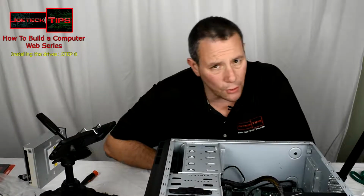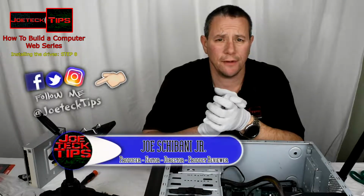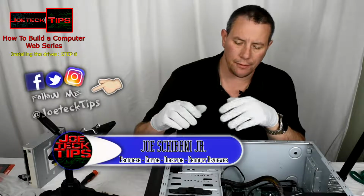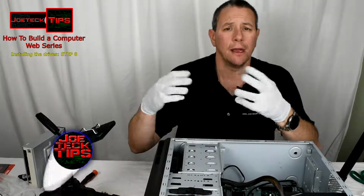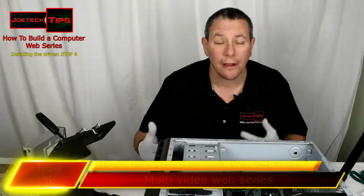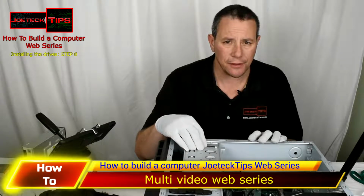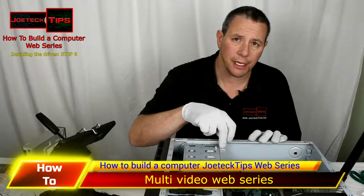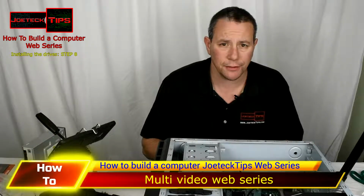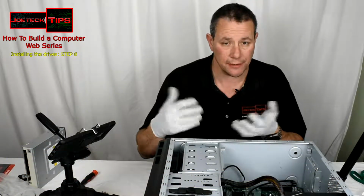Okay, now we're going to be installing the hardware, such as the SSD, mechanical hard drive, if that's the case, and a solid state drive. Now, this case here, this chassis here, actually has the support for either a solid state drive or a mechanical hard drive, which is nice. This has the 3.5-inch slots, but included in this particular bay has a 2.5-inch drive bay as well for the SSD, which will be very helpful in this installation.